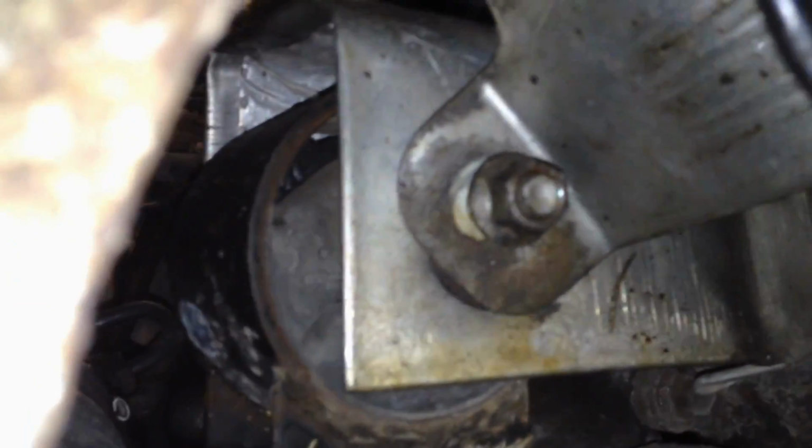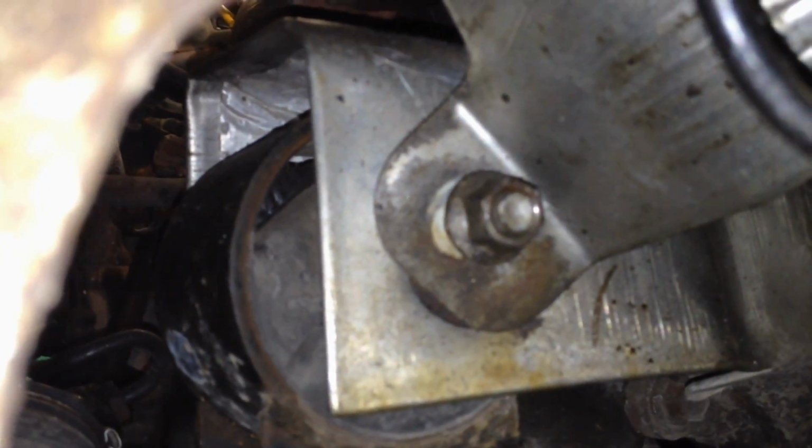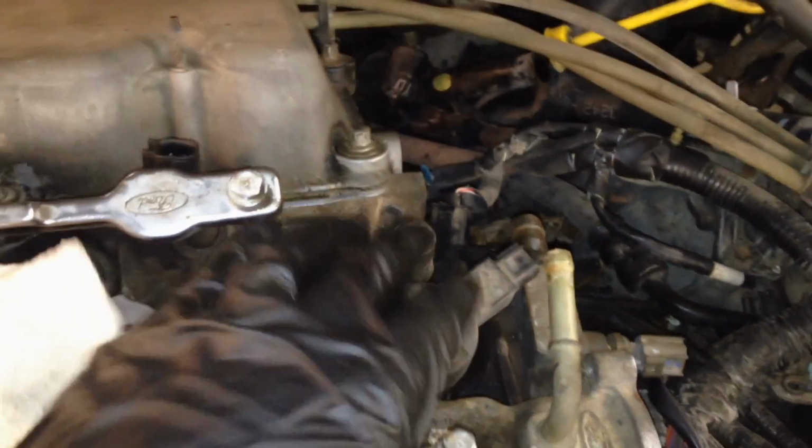And then over here in the wheel well opening, there's another nut. Tighten all those up. We can move on to the accessory drive bracket. Put your cam sensor back on. Tighten these 2 bolts right here. So that's all sealed up.